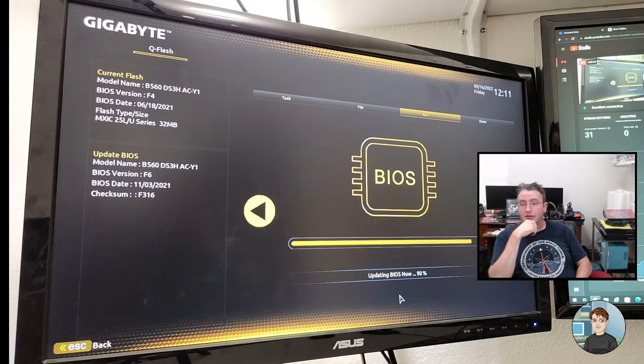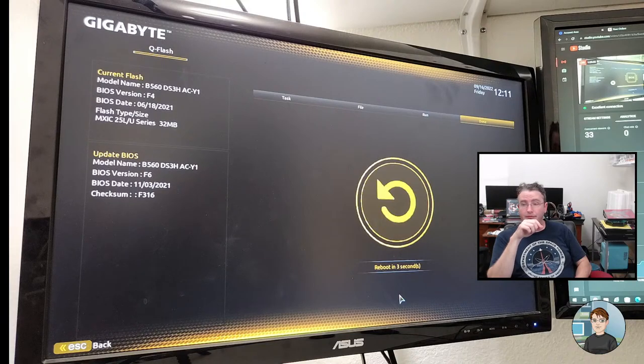It's an ASUS, I'm sorry, it's an HP laptop. Yeah, look for a BIOS update. But also try the mouse in a different spot. Or are you talking about the trackpad? If it's a trackpad, definitely look for an updated trackpad driver. Another thing you can do with trackpads, if you go into Device Manager, find where the trackpad is, right click on it, go to drivers, and try changing the driver from what it is right now to a more basic one. Sometimes it'll get rid of weird problems like that.